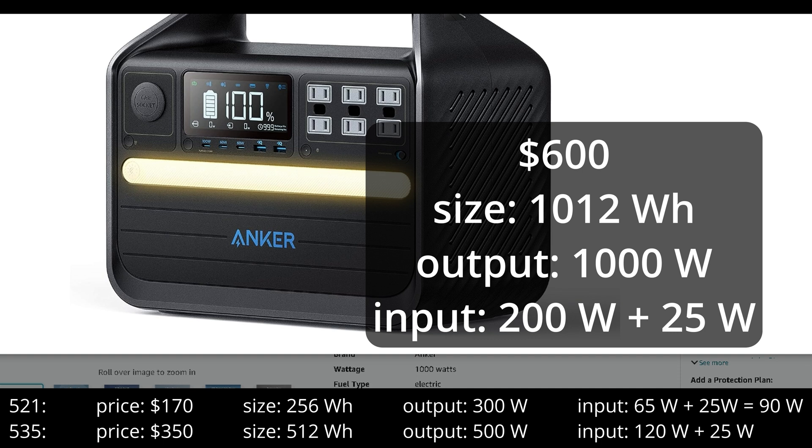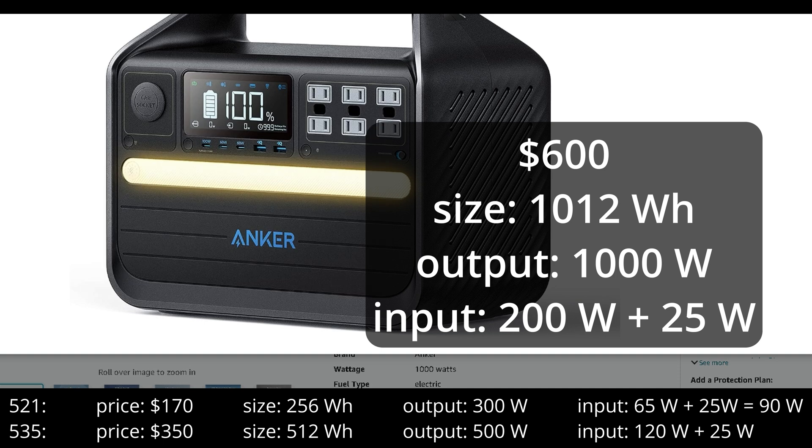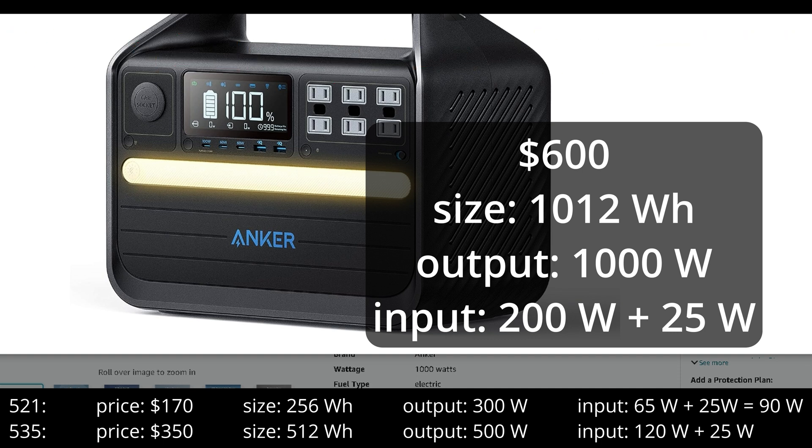I got this mainly to power my air fryer. To save money on all the trips I take, it is a lifesaver for convenience. When you charge and you're super low, it'll take 30-40 minutes to charge — pop some food in the air fryer, wait 10 minutes to heat up, eat for 30 minutes, and you're done charging. Going back to the 200 watts input, you can also add another 25 watts from the USB-C from the Tesla. The USB-C port alone accepts 100 watts input and can also output 100 watts. You now have three USB-C slots, with the others supporting 60 watts. With 200 watts input, you can easily power your underglow and anything else without draining the battery at all — I never drain it on normal use. These are lithium phosphate cells, so leaving them at 100% is more okay than lithium-ion.